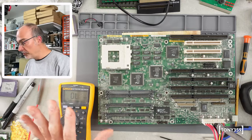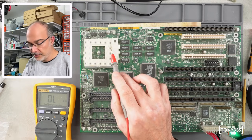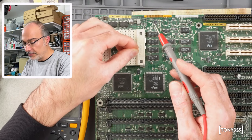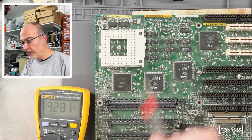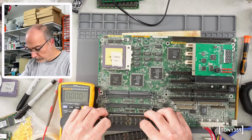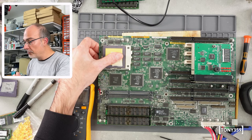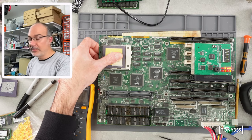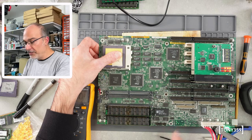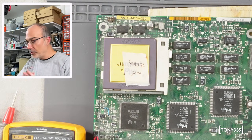Ready to power up — no tantalums on this board, so should be safe. We got 4.8 volts which is what I'm expecting — around 5 volts. Let me check the other side of the CPU: 4.8, perfect. Let's plug the CPU. I've got the CPU in with the post analyzer and buzzer. Let's turn it on. Nothing — it's completely dead. No post code, not even 0.1 or anything. The CPU is getting lukewarm, nothing serious. The CPU is also not tested so I have no idea whether it's working. So this is just a total disaster — definitely not something to resolve on this video.